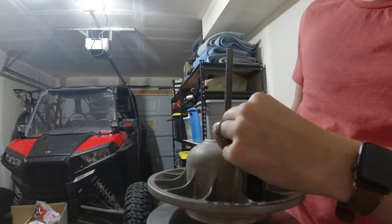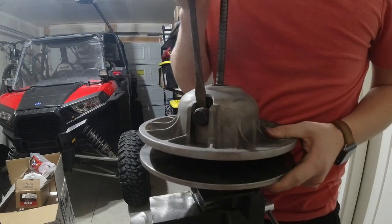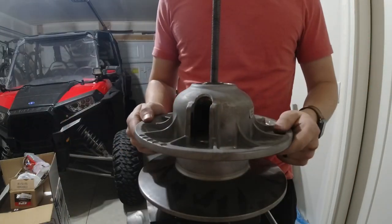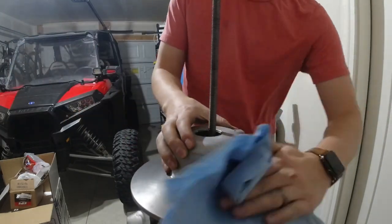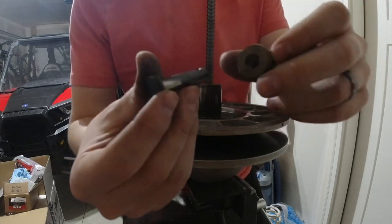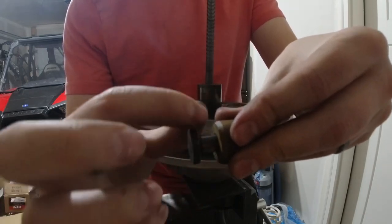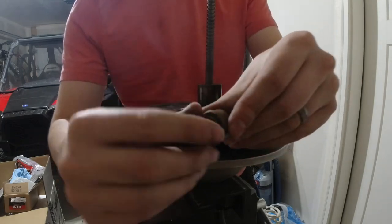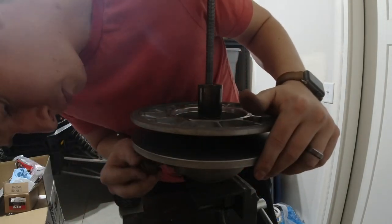There's the little pin. Now that we've got the pins punched out of both sides, I'm going to take a flathead screwdriver and pry these rollers out. We've got the pin out — that's what that looks like. Now that the roller pins are out, I'm going to slide these parts off of each other and wipe that down. These are my new rollers. Install with the flat side against the head of the pin — one side is flat and one has a bevel. The flat portion on the pin head is going to be pointing up toward the engine. Make sure the hole in the pin is aligned with the hole we'll run the roller pin through as well.